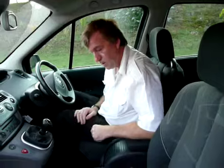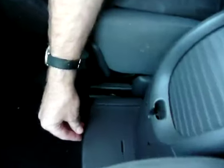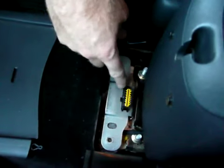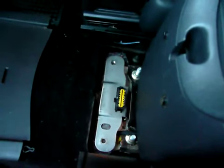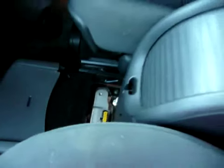If you just look over here, this is the Renault Scenic 2005 model. If I remove a cover plate, you'll see there's the connector. These connectors are always in vehicles beyond 1997. Various locations — you might find them behind the ashtray, underneath the steering wheel — but they're always within about three foot of the steering wheel.